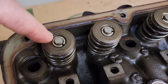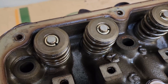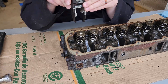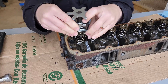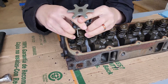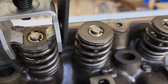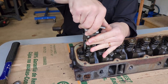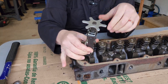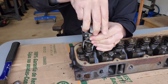The valves are held in by these two retaining clips. They sit down in a cup, and the spring pushes the retainer up so they stay in place. To get those out, we are going to use this valve spring compressor. It's a pretty simple little job. Just put your compressor down over and find a spot where it'll actually fit into the springs without popping out. Once you get it set up, make sure these little tines in here aren't covering up the clips, otherwise they won't come out. Now it's just a matter of tightening it down to compress the spring. Give it a little pinch down here on the bottom and make sure it's seated well on the spring. You don't want the spring to decompress while you're holding it, because that would not be fun.